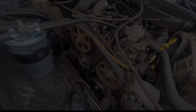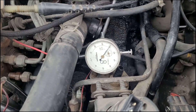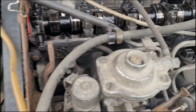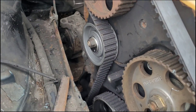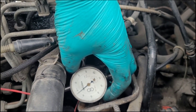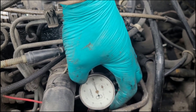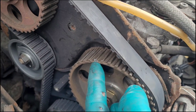Now we're stepping up a bit - we have our dial gauge out. There's a 12mm bolt in the back of the fuel pump; undo that and make sure it's all clean around there. We've got the dial gauge sitting in the back. Make sure the engine is at TDC with that mark lined up, the cam is horizontal with the head, and the dial gauge is bolted on nice and tight. Rotate the engine backwards about an eighth of a turn, or until the flywheel pointer is at about half ten, then zero the dial gauge. Make sure it's bolted tight because loose fittings can give skewed readings and you'll end up chasing your tail. Factory setting is about 0.037 of an inch - I've set this one to 40 thou.